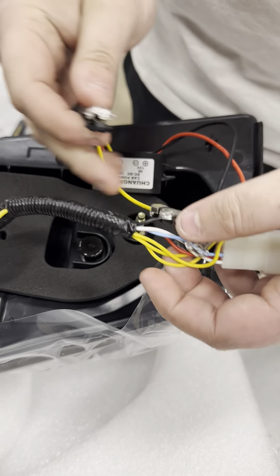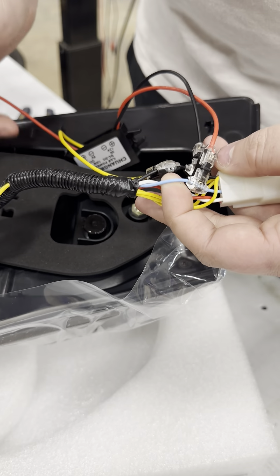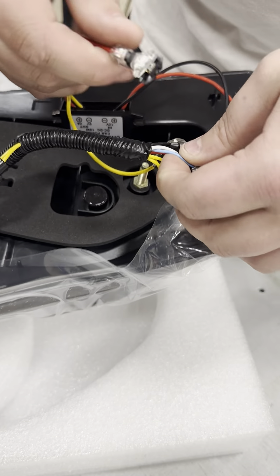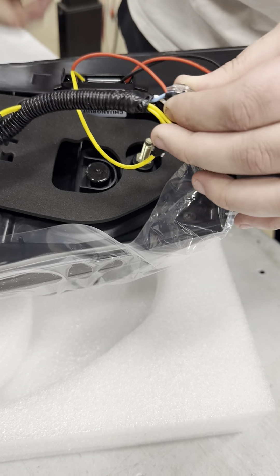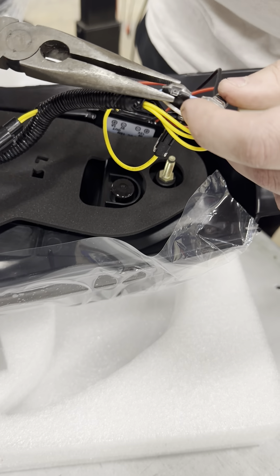The other red wire is going to go past the first connection on the side of the headlights, because we want power to flow into the module and then out this wire. We're going to connect this one to the blue wire and just clamp that down.